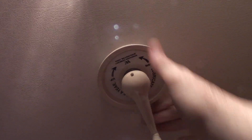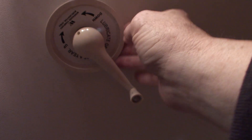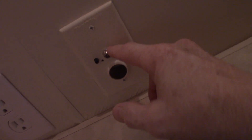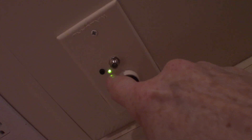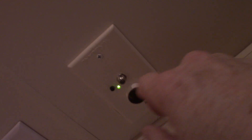This is your antenna — it cranks up and rotates. It goes clockwise to go up, raising your antenna on the roof. When it's up you can pull this down and spin this whole dial and it'll actually rotate the antenna to tune things in. When you set it back down you always want these two arrows to be lined up so it lays in the proper position. This is where your TV hooks up right here, and that button I pushed — you saw it light up green — you're going to have to have that on when you're using the antenna. That's the digital signal booster for the antenna, so you always want to have that on if you're using the antenna.